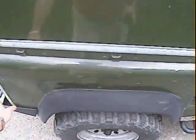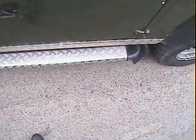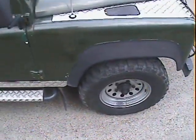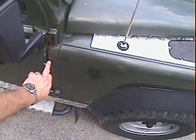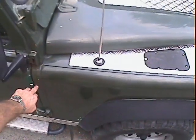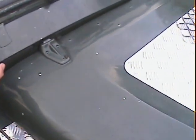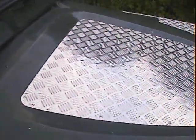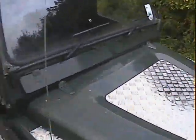The dented area above the wheel arch has been painted in slightly the wrong colour green — too dark. If you touched it in with the right colour green to match it would be a lot better. There's also a bit touched in that's too light a shade of green, and some electrolytic reaction on the bottom of the driver's door. Where the check strap stretched and folded the door it's broken the paint slightly — probably the worst bit on the car. Looking up at the vent panel, it's starting to delaminate slightly around the top of the vent, possibly had a little bit of work there in the past, but still got a fair bit of life in it yet.